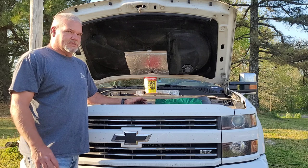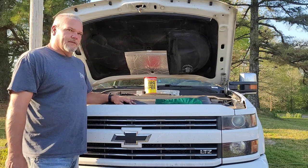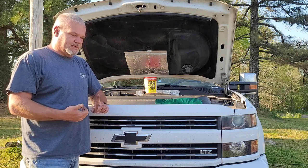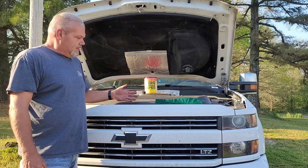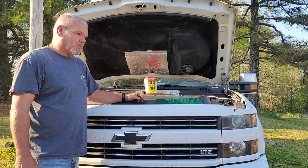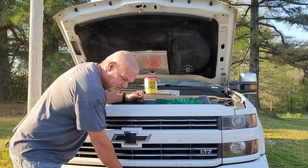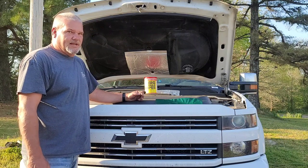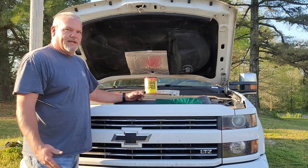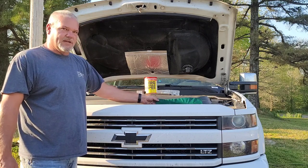It's at 376,700 and some change. That 400,000 mile mark is coming right up, and that's another reason I'm trying to take care of it. Since I've been working on it today I've changed the fuel filter, oil filter, air filter, and serviced the transmission fluid and filter. If you guys have not already checked your transmission lines — the bottom passenger side corner coming off the oil cooler, right behind the grill — go ahead and check that out. It's a miracle they haven't already rubbed a hole in them. I'll either cover it in this video or make a separate video since it's pretty important.